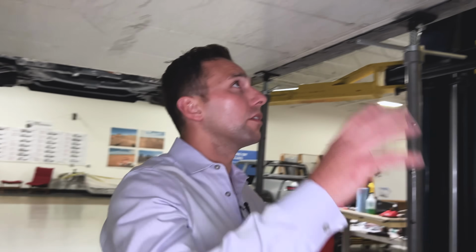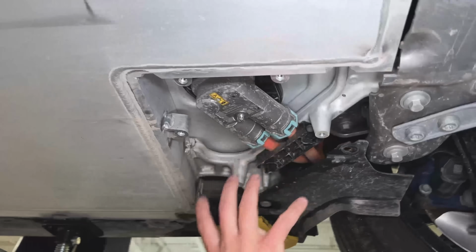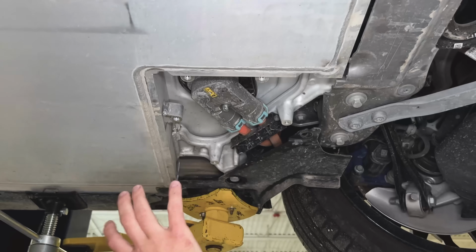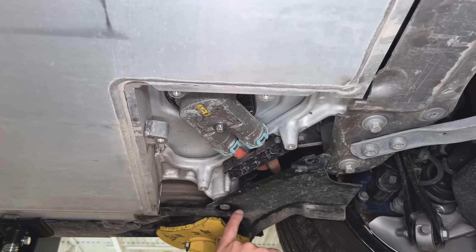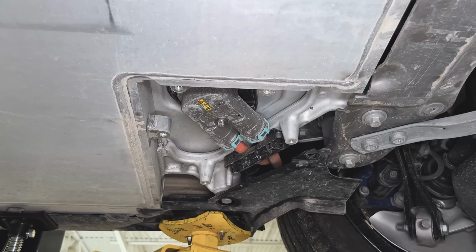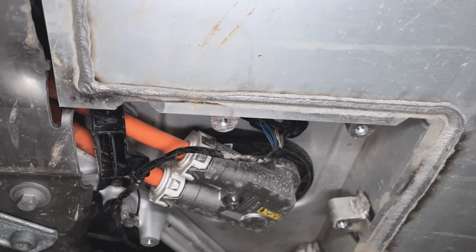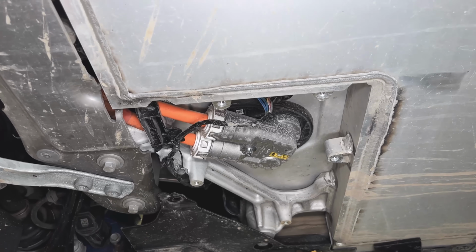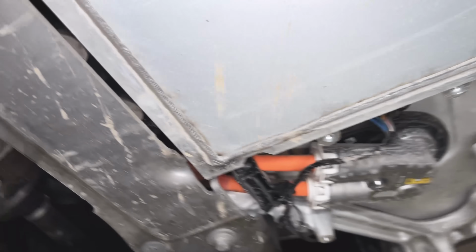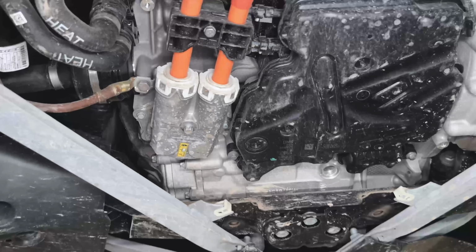When we were talking about the ground plane, the pockets where these forgings lie house this connector, which I believe goes to their plug-in port. Right, so you've got your two lines going to your charge port, and then on the opposing side, we've got another high voltage connector which snakes up and over this little shield, and then goes vertically into the underside of the motor assembly.